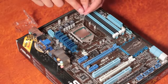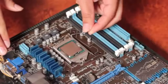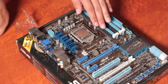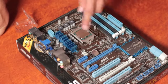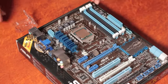And now it's usually at this point here that you hear a few unwelcome creaks and sounds. I'll be quiet for a second, so hopefully we can pick them up in the sound. Now in placing that arm back down, you do have to exert some force. This is perfectly normal if the CPU is placed in the correct orientation and seated flat. So it's the same, just as we uninstalled it. Arm out, down and under, and that's your CPU installed.